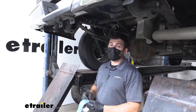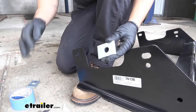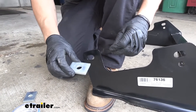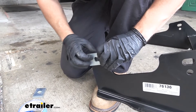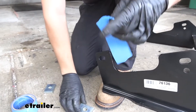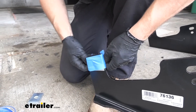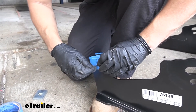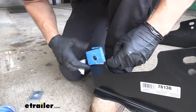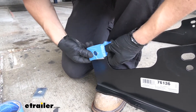We're going to repeat that same process on the other side of the vehicle. Next, we're going to take our hitch and the spacer blocks that come in our kit. We're going to work on the mounting hole furthest away from the cross beam, on the outside of the flange. Similar to our last step, we're going to tape the spacer block to the outside flange, making sure we line up the hole in the spacer with the hole in our hitch. We'll take some masking tape to secure it in position, then take a razor blade and remove the tape from the center of that hole. If it's not fully aligned, you can readjust the tape until it's seated properly. We'll be doing this on both sides.